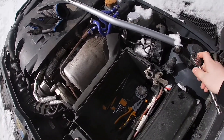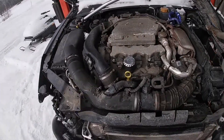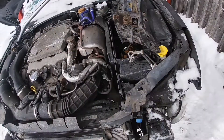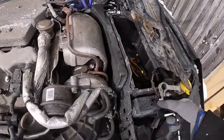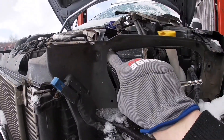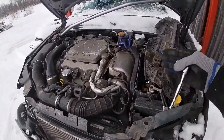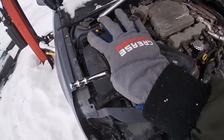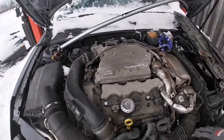I got the top plastic off the engine and removed this plate. Basically there is a pin for your hood release right here - that clip you have to push out through that hole right there, and then you can move it up and out of the way to the side. Now we're gonna get rid of the stock air box and the pipes right here that connect to the turbo, since that has to be replaced anyway and it's in the way to get the intercooler and radiator in.